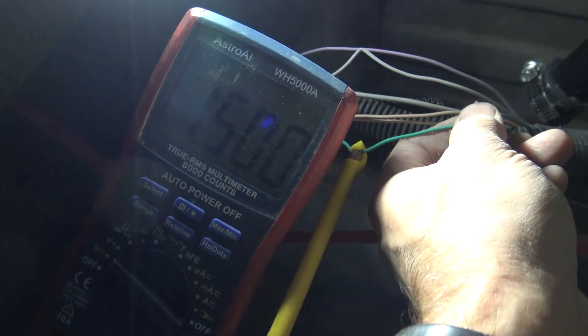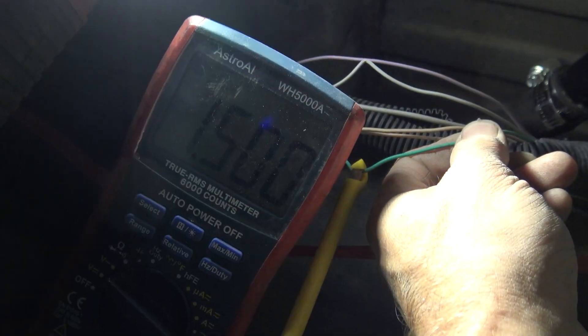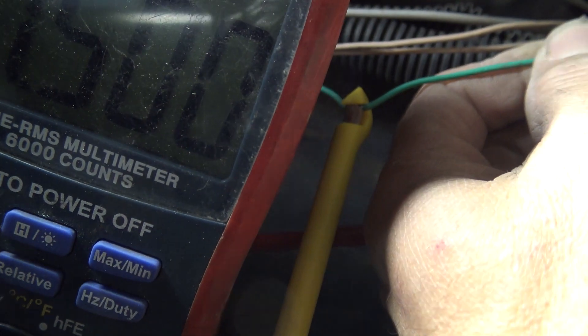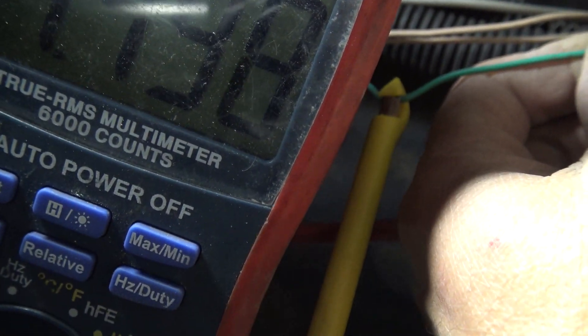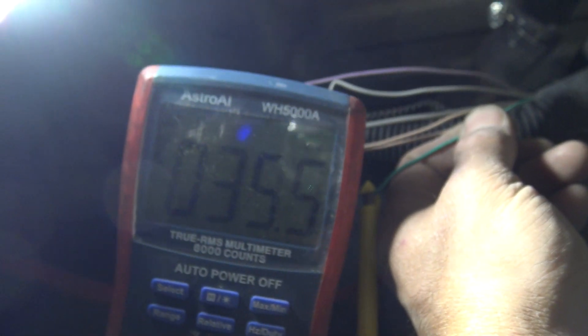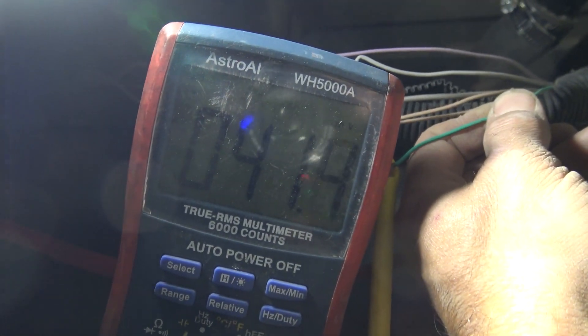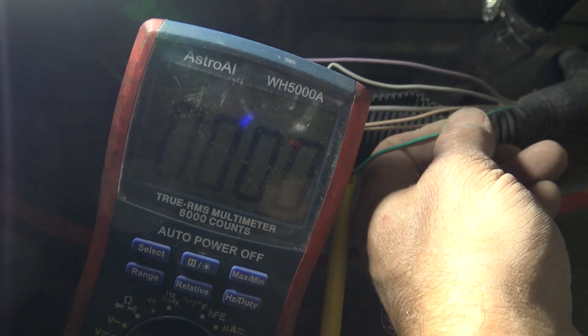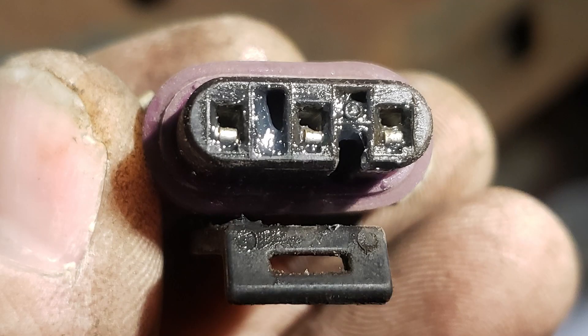So I started trying to access the fuel tank — real hard to get to — but I ended up pushing and pulling on that wire, and I could get 1.5 volts to show up on that green circuit. So I knew our problem was between those two points on the vehicle. At that point we dropped the tank a little bit, and I was able to find out that we had some very spread terminals for our fuel tank pressure sensor. The shop is going to go ahead and replace that pigtail and get that thing rolling.